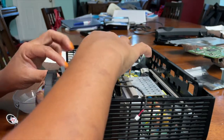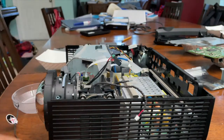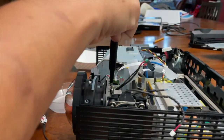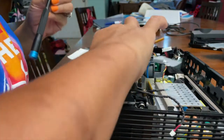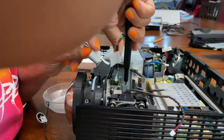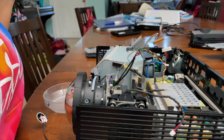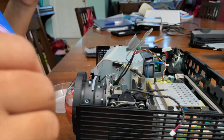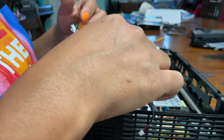There's 3 screws to put the color wheel back in. 1 on that very front piece, it's a deep screw, and then 2 that connects the color wheel back to the lamp body, the light body. 2 screws left right there. Okay, so now we're going to start putting the motherboard back in. Put this small bracket back in place with 2 screws.